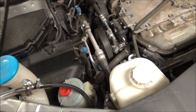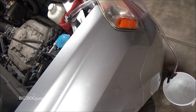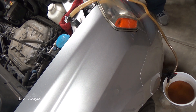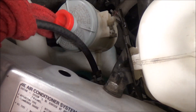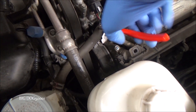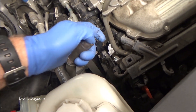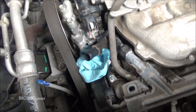This won't get every last drop, but we'll get the majority of it. So we'll go fire up the vehicle and pump that old fluid out. Once we start up the vehicle, it doesn't take long to get all that old power steering fluid out. Now that we've got most of that old fluid out, I'm going to go ahead and pull my hose out of here. Now seeing as it's just one little clamp right here, we'll go ahead and get our reservoir out of our way. I didn't heed my own advice — I should have put the rags down before I disconnected that. But anyway, I got it cleaned up.